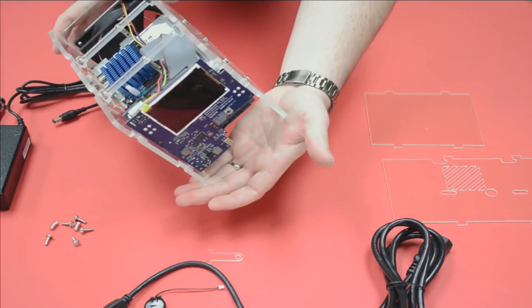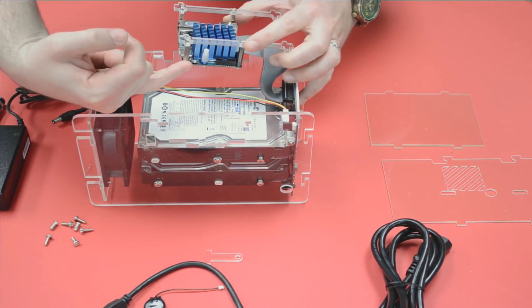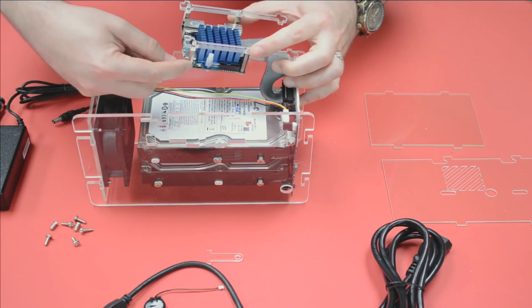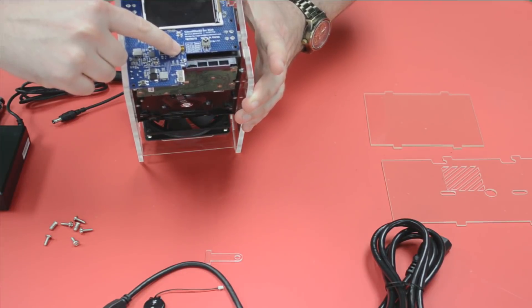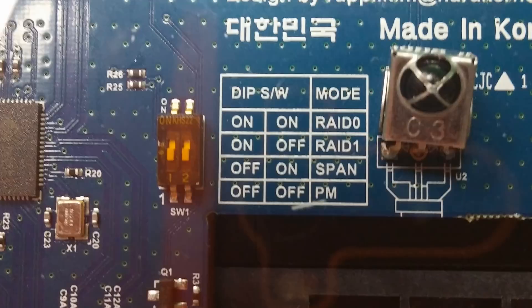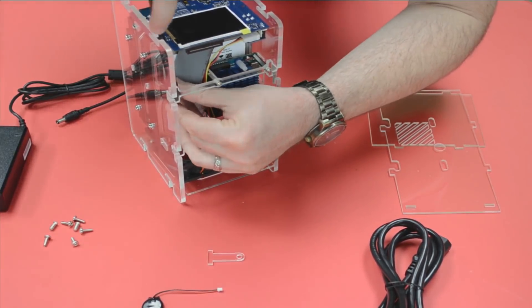The screen is a color computer screen and every bit of signal goes through this cable. Now the final step is connecting the SATA controller. There's a little dip switch that selects between the eMMC and the SD card. There's also a dip switch for the RAID controller — this allows me to select RAID 0, RAID 1, SPAN or JBOD, and PM mode. PM is basically default, independent hard drive mode. Both switches will be off. Then we plug in this USB 3 cable.